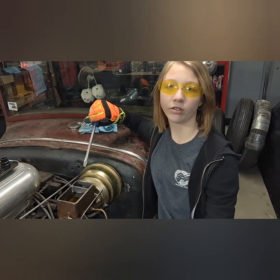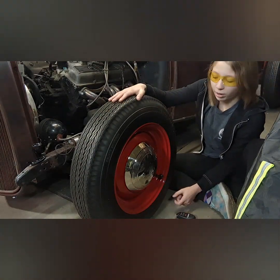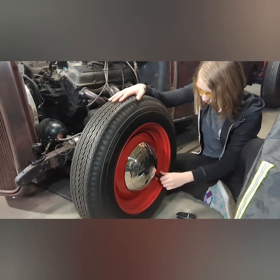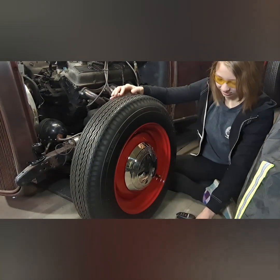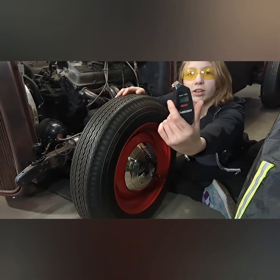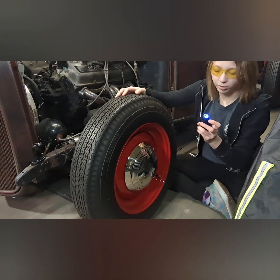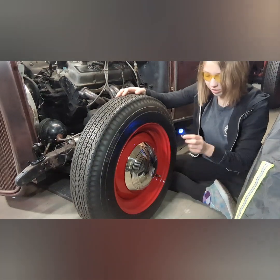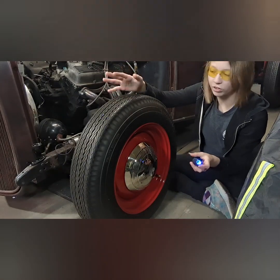Might as well check the tires. So I'm going to check this tire — already checked the other three, just didn't want to waste time on it. I'm going to unscrew the valve stem cover. My dad probably should have asked me about this before putting it on — he also got this gauge at Home Depot. Let me turn it on and make sure it's on PSI. We got 20 PSI in here — no wonder it's low — it should have 35 in here.